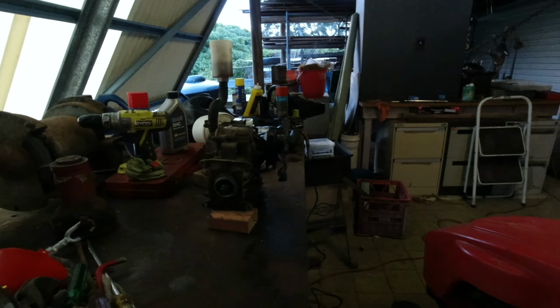I mean, if you're in a hurry, this would be frustrating. I find it quite fascinating. I just want to get the exact amount of oil in there so there's no air pockets, so there's no reason for it to cavitate. I might find out why cavitation is so bad for hydraulic motors and pumps. It's quite destructive, cavitation. Give me little bubbles every now and then. Little bubbles like that. Sometimes it's a big bubble.